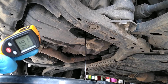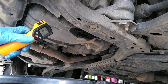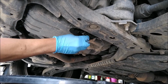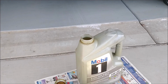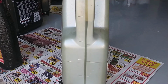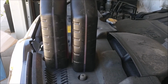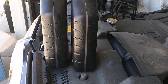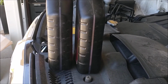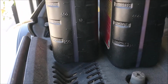The fluid comes out. Remember, the engine is off. Okay, let's check how much oil came out. See, this is 1, 2, 3, 4, 4 quarts total minus the 2 quarts I have there. So the 2 quarts came out and I put 3 quarts in, so there's 1 quart inside. Okay, because I did not have the engine running, I have extra fluid that came out, so I need to add more. So I did the math and it takes about another 1.2 quarts in order to match the exact amount that drained out. So I'm going to add another 1.2 quarts, which is around here.